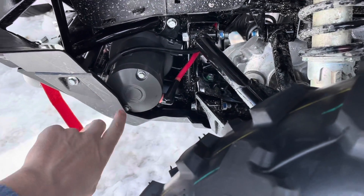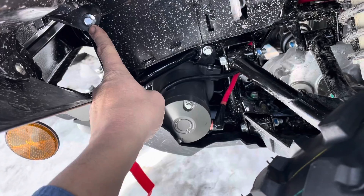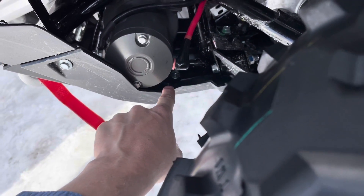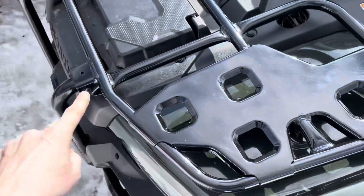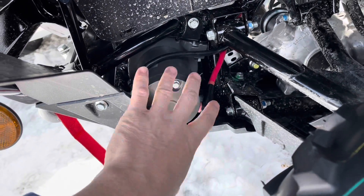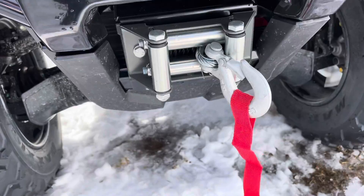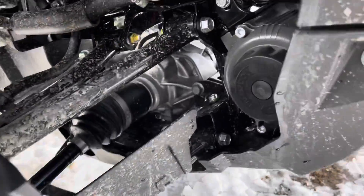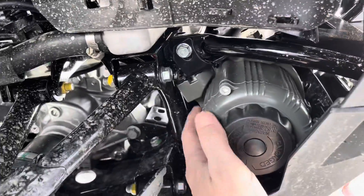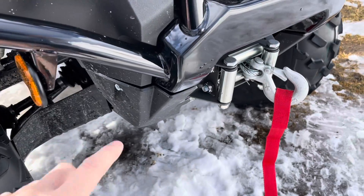The motor is here on this side — it's really close on the skid plate. I drop the skid plate down; it separates right here, with bolts here, here, and one more down there. To get the bumper off there's also this top bolt here. The wires are on this side, the motor is on this side, and on the other side there's a free spool mechanism. Out front you've got the fairlead, and over here is a free spool mechanism and planetary gear — this is a big planetary gear. That's why I went for the 4,000 pound winch — if it doesn't have the planetary gear on this end, I think they're pretty much useless. They have a better braking system and better planetary gear.